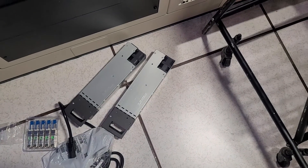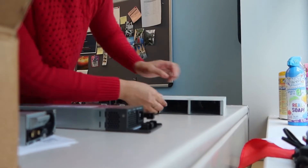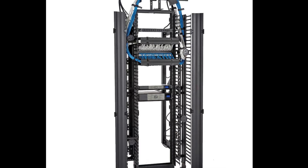Put the power supply unit back into the switch so we can plug it into the power strip. Best practice: we have two power supplies in the switch so we use two power cables, plugging each into a different side of the rack — one goes to the main power and one goes to the generator or backup. That way if there's a power outage, the switch can still run on backup power.